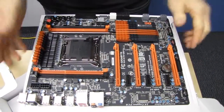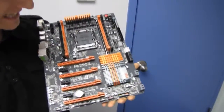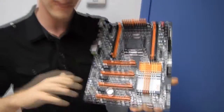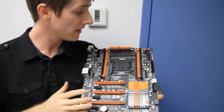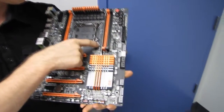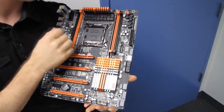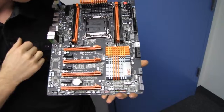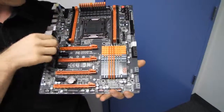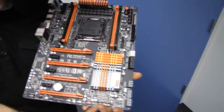Let's start with the overall layout of this board. This is an XL ATX — extra large ATX — motherboard. It has seven expansion slots, which is very difficult to do on a regular ATX X79 board for a couple of reasons: the extremely large CPU socket, the extremely large and robust power delivery systems due to the power-hungry CPUs, and the fact that memory now goes on either side of the socket per Intel's recommended design.